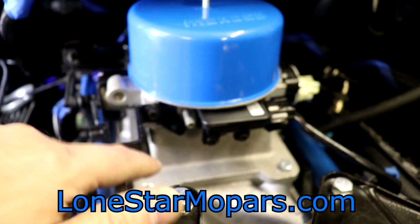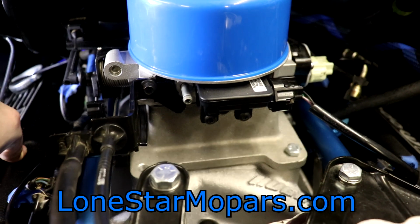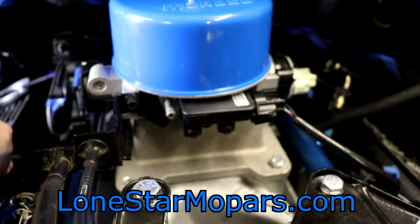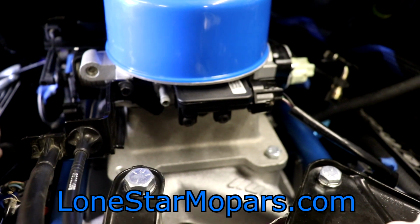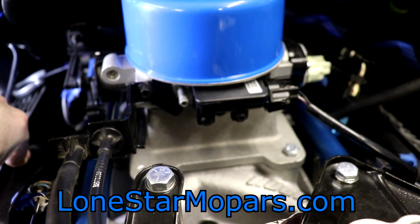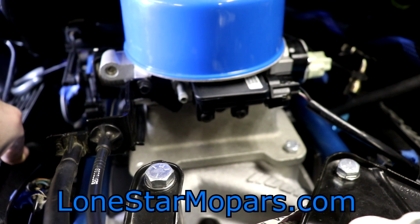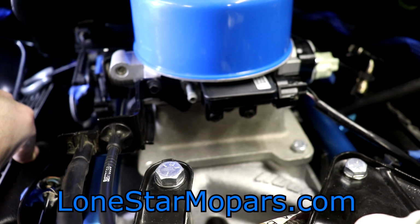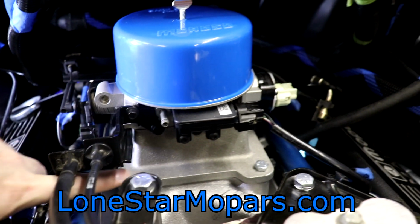I shot off an email to get the exact torque, and I've not heard back from Hughes, so maybe they'll respond. It's been several days, so I'm not sure they will. If not, I'll just go with the size of the fastener, which I think is 5/16, so won't be anything too crazy. My big deal, there's a gasket there. I just didn't want to tear it up or have a vacuum leak that's then later hard to diagnose. So stainless fastener still to come there.